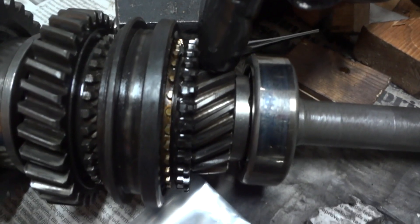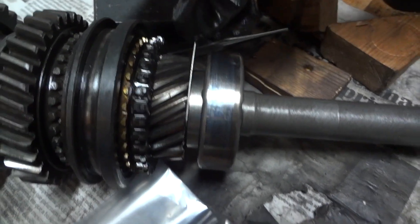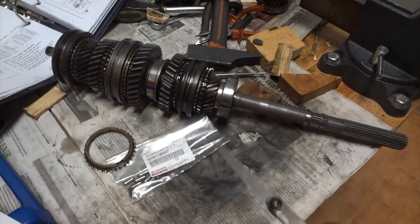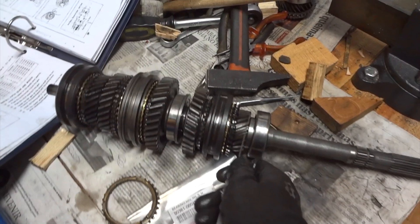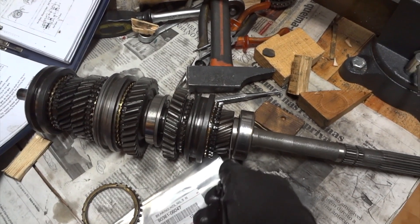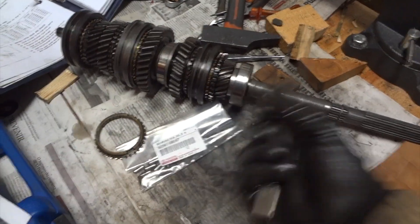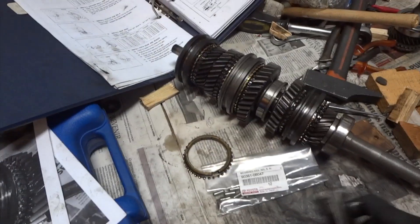And finally, for the fifth gear, the tolerance is 1.0 maximum. The blade fits this time — but it's a much larger tolerance. So I'll take out the 0.7mm blade and try to put it between the spacer and the gear, and it doesn't fit. So this tolerance is well within limits — it's under 0.7mm. All tolerances for this gearbox are checked and it's perfectly okay.